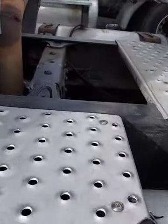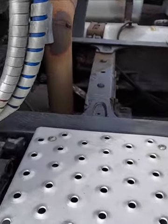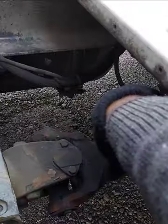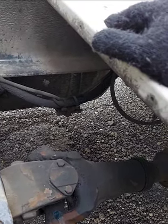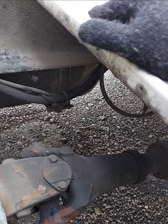My catwalk — this is my catwalk — secure, no damage. I got my drive shaft — I'm going to show you, this is the drive shaft — secure, no bent or twisted. I will physically inspect that there is no play on the U-joint.